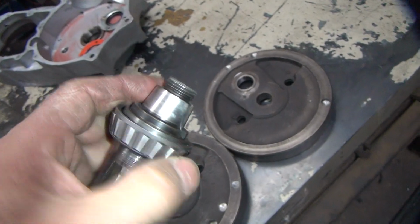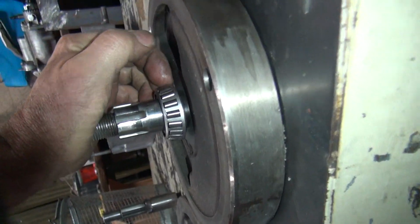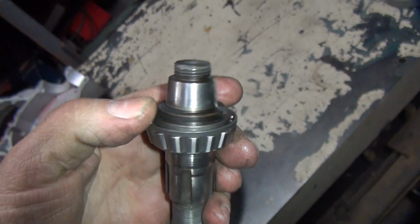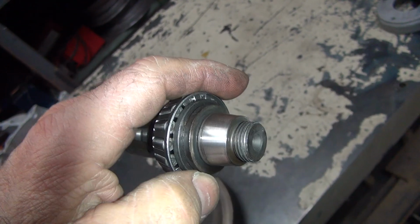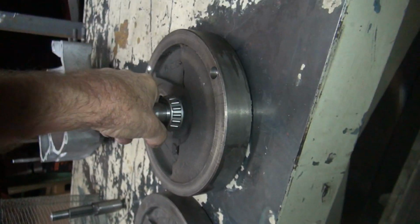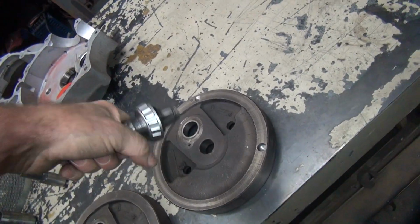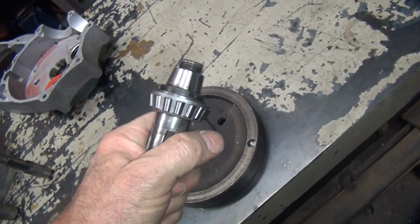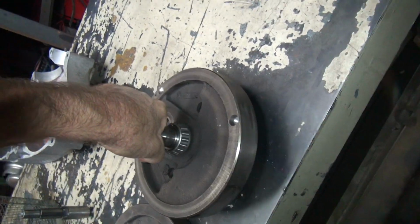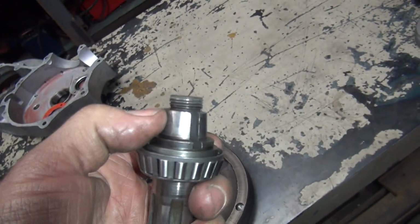Okay, this is our bearing that goes in here. So you want to push that all in and make sure you got clearance under there. If this bottoms out against this shoulder here, it's loose. I don't care if the nut's tight, it's loose. It'll come out. I just had one customer ask about that. See how tight that is? That's a wedge. You twist it in like that. It's a taper. It'll lock it. If it's a good tight fit, it'll work. If it's a crappy taper, it won't do that, see? It's a good taper. That means it matches real nice. That's what's nice about a taper.